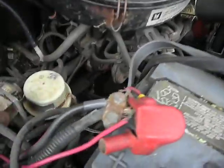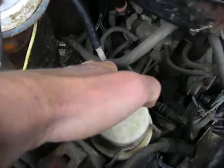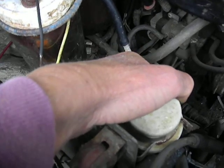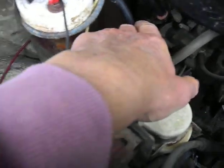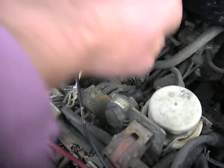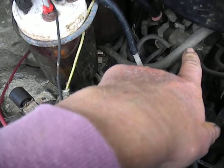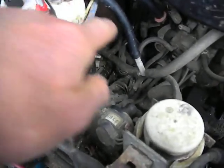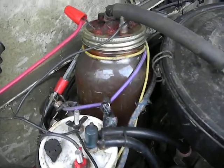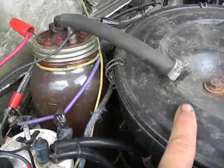On this system, I've got one coming in from the evaporator — right from the fume intake, from the gas tank. This is the line that comes from the evaporator from the gas tank, and what I've done is put the HHO feed into that. And then I've also got another one here where I just feed it directly into the top of the air intake.